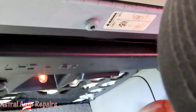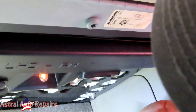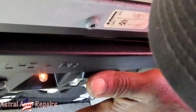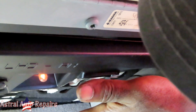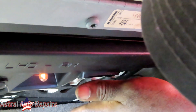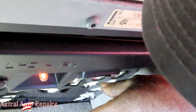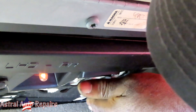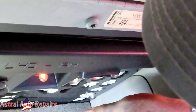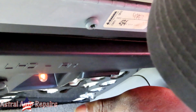We are now in DEFCON 2. We need to see what's going on with the complete system. What we're going to do is hook up our Autel MK908 so we can run through all the systems — including the theft deterrent. Maybe it's a theft deterrent problem. We're going to see if there are codes in any other system that might cause this thing not to start.